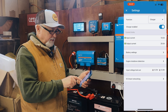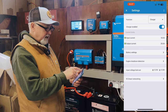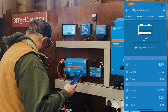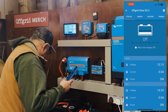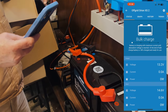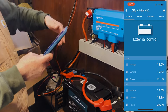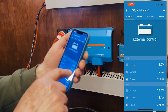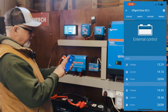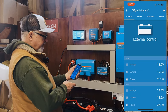There's no way I'm going to change the input voltage lockout — you shouldn't really mess around with that unless you really know that your alternator is okay. So those are the settings. I'm going to turn this charger on. What I've got over here is a charger to simulate an alternator, so we haven't actually connected this to a vehicle. It has triggered on now — it's pulling 17 amps. The output is at 19.6 and the input current is at 18.4, so that's cool. In a caravan setting, this would be perfect for what he wants to do.